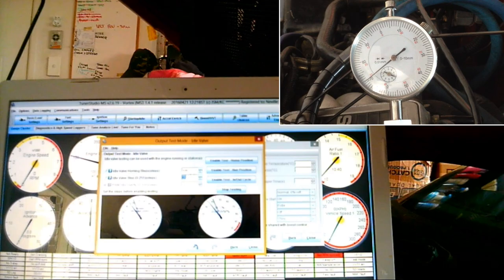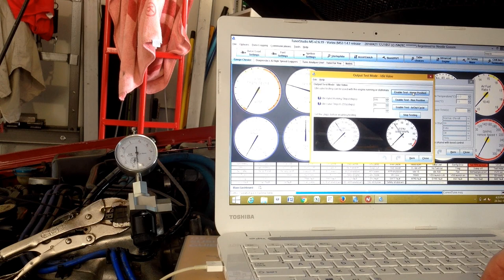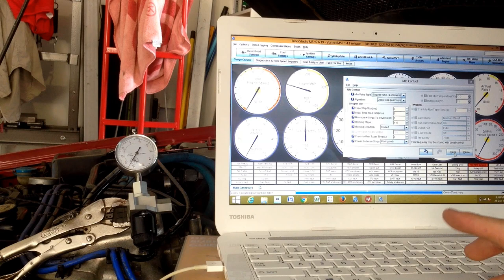So cool. Now it goes closed when I home it. And then 96 steps and she's fully open. So with a homing step setting of 110, no matter where the valve is, it's always going to close. And now it's going the right direction too. So yeah, cool. Time to try it with the engine running, I reckon.